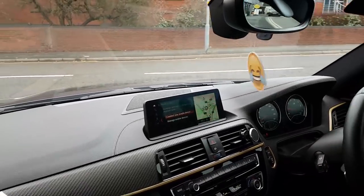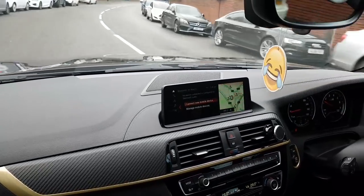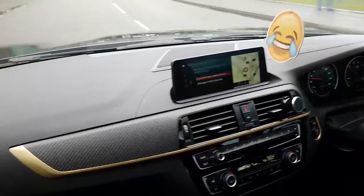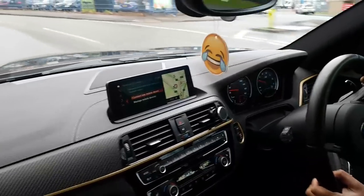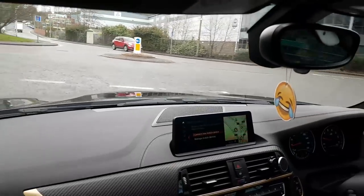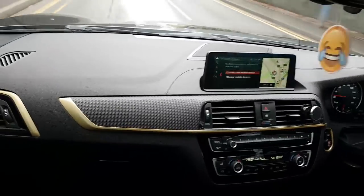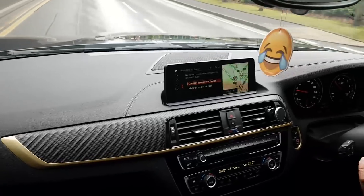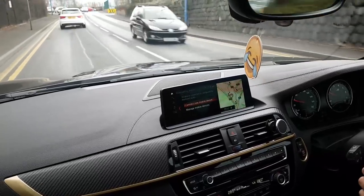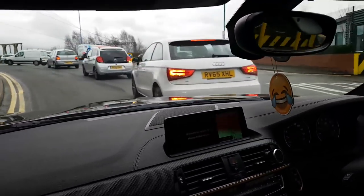It's a bit damp today so we can't really take it to its limits on the road. The feel is quite good - it's got good feedback on the steering wheel, it's a bit sharper. We've still got to bed it in and take it for tracking, but looking at the data it's about as straight and true as possible. The rear camber is a bit more than it should be, so we can adjust that when we take it for alignment. On the rougher roads you can feel it being a bit stiffer, but it's in no way hindering the drive of this M car.